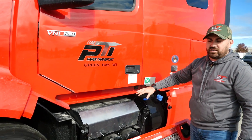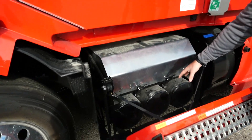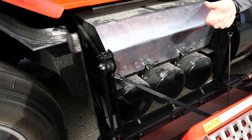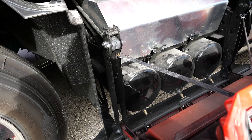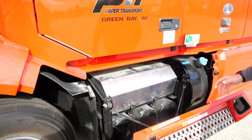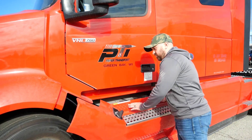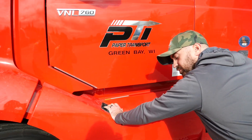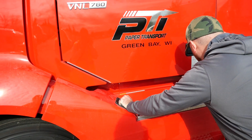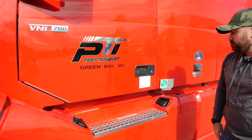When we need to shut our batteries off, another thing to point out is right here underneath the batteries we have the air tanks. You need to drain your air tanks daily — it's going to be right here underneath the batteries, so all this is housed in one area. Putting it back together is relatively simple: you have two levers, push the fairing back into place, and snap the two clips back in to lock it.